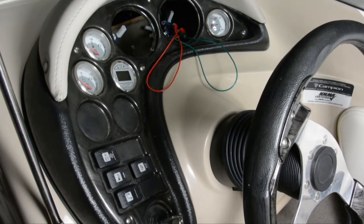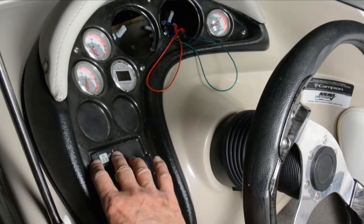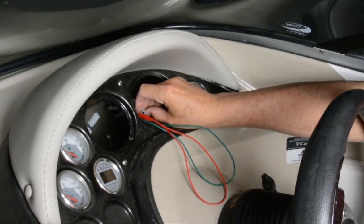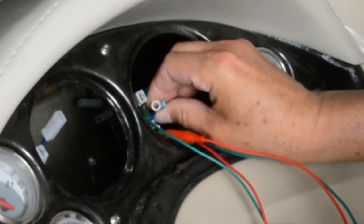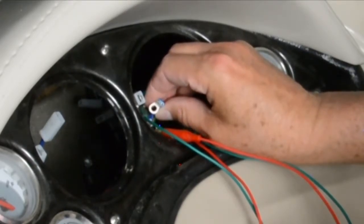To test this, I put small alligator clips on the two sets of wires where they were going to the same post. What I need to check is that when I fire up the engine to the run position, all my gauges wake up — you can see them starting to jump to life. Also check that when you turn your nav lights on, your gauges are illuminated. As long as that's working properly, you're good to go. I always like to conserve existing wiring as much as possible, but a bad crimp from a cheap crimp tool can almost miss and create long-term problems.